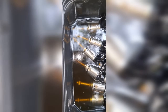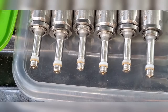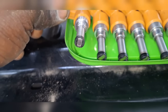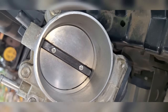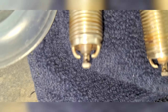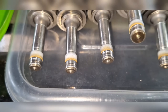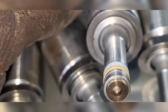You can see the cleaning solution has broken down all the carbon compounds — the solution is heavily degraded from the cleaning. We're back from cleaning now. You can see the high pressure fuel nozzle tips are so clean compared to before, the low pressure nozzles are clean and clear, the throttle body is now very clean — almost new — and the spark plugs are all gapped and ready for installation at 0.039 inches. You can even see the fine spray pattern on the high pressure nozzle tips.